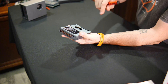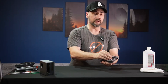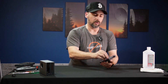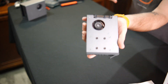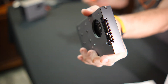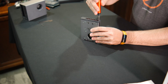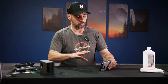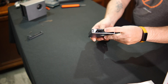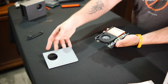I'm just going to jump into this. This is the DG card by Gold Shell. What we're going to want to do is rip off this label and put it off to the side. There's a sticky pad under it — we're going to rip that off as well because we need access to four screws underneath it. Next, we'll take off four screws on the end where the SATA ports are and take that little plate off. On this side there's a screw that's front-facing and a screw that's side-facing — we'll take off that end cap. From here, there's a top plate and a bottom plate, and the PCB is kind of squished in between. The top plate where the fan side is just slides right off.